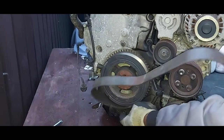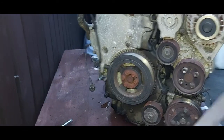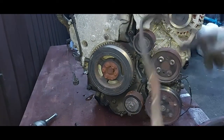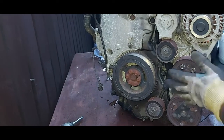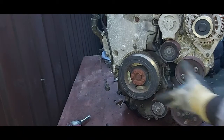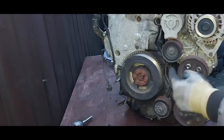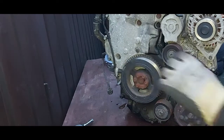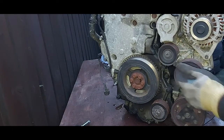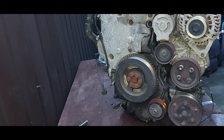Please, let me say this to you. If you do not have a diagram of how this belt is routed, before you remove it, just make a sketch on a piece of paper. Draw these pulleys, try to show the size difference. You can name them as well — crank, tensioner, water pump, alternator, air condition, and the idler.